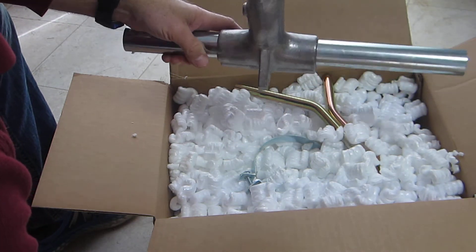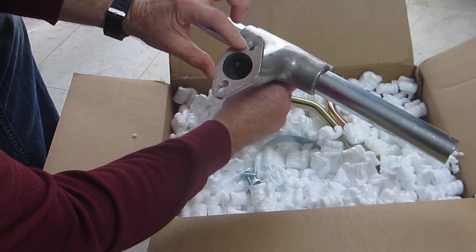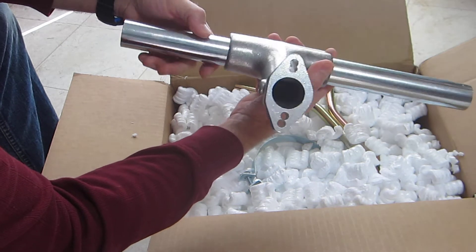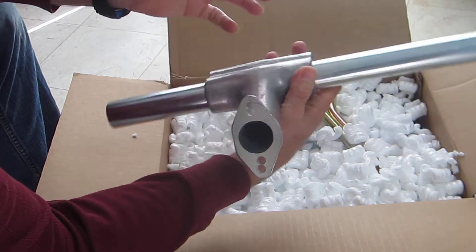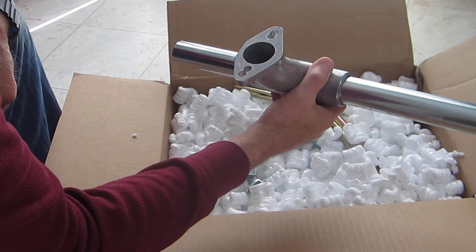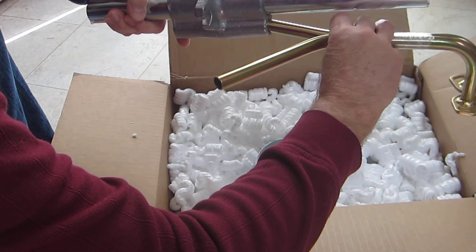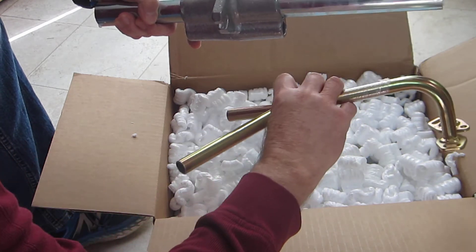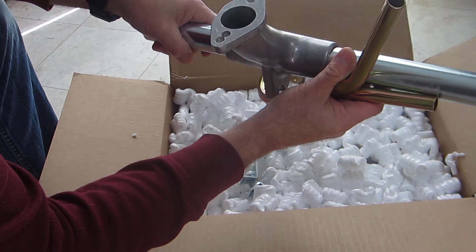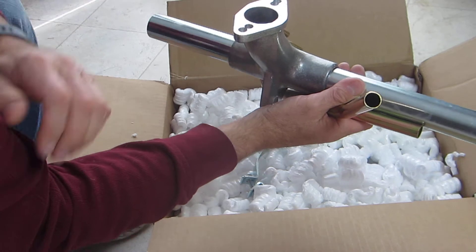As you know, the 40 horsepower engines in 1965 jumped to 50 horsepower for 1966 based on improved heads and a larger crankshaft. This manifold, once I secure some ends for it, can be used with either a late-model carburetor — a stock 34 PICT — or an earlier 30 PICT. It's got bolt hole spacing for both. CB Performance says this manifold outflows some other castings. The end pieces actually come with it. The 2332 will be equipped with either 48 IDA or 48 IDF carburetors — I'll do another video on that.